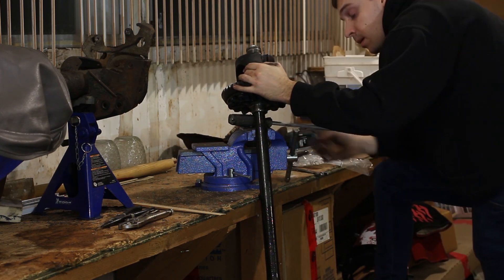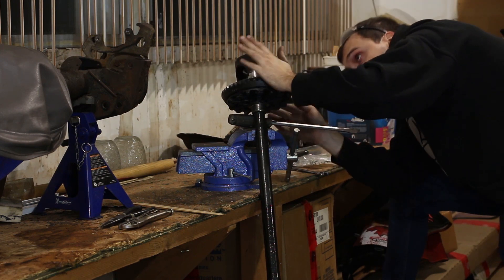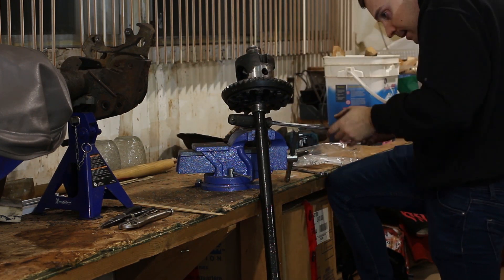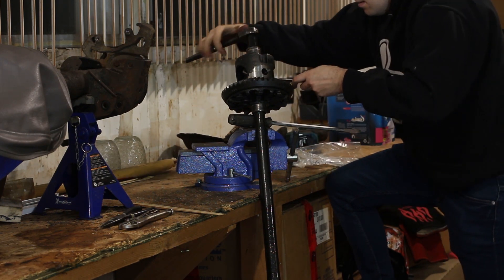What you need to do is put an axle shaft in a bench vise, place the carrier on the axle shaft, compress the opposite side gear clutch pack with a bolt, nut, and two thick washers. The washers that hold a grinding disc to an angle grinder fit perfectly for this.